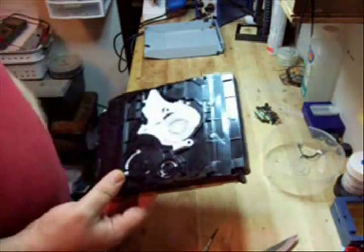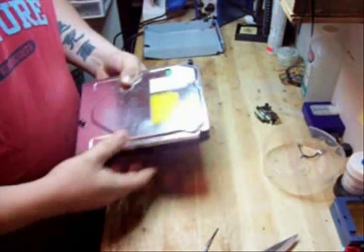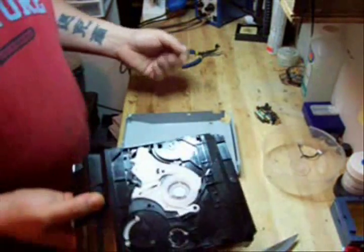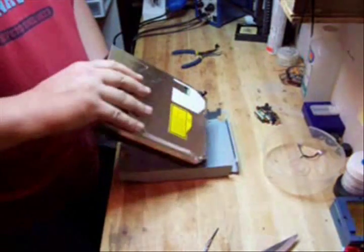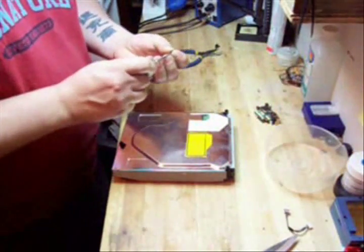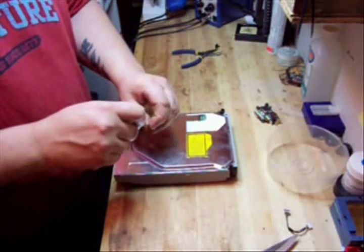Now we get the drive back together. What I like to do is not put the top cover on it until I actually put the drive in and test it once — so I leave the cover off and put it back in like so. But we're going to show you how to put the cover back on. After you're done testing it and you know the drive works and reads, you've got to take it back out and put the top cover back on. I always bend this back a little, slide it in front first, and drop the back in. Now put our four screws back in — two black ones go up at the top where the disc inserts, and the silver screws go on the bottom.